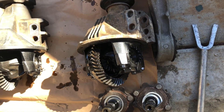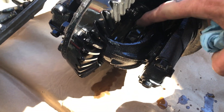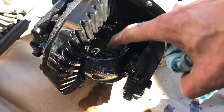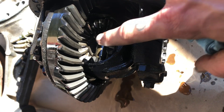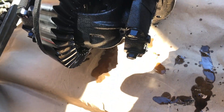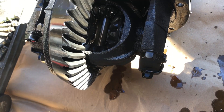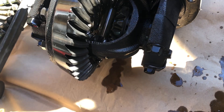So what we're looking to fix — and by fix I mean weld the crap out of — is right there in the spider gears. See how those turn? We don't want those to turn anymore; we want to make it one solid unit. We're going to weld all in here, and find a way to get in from the other angles using MIG. We have to turn it over and do it again, making sure we don't get into where the axle shaft will come. We can also put in a little metal plate in there.